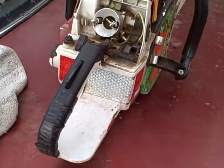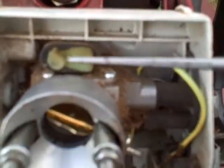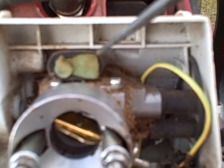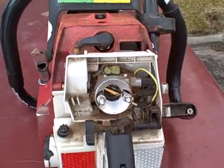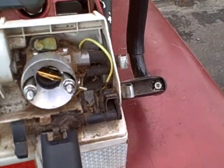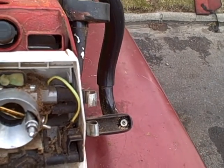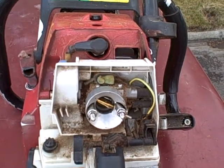Right across here is the most critical. Huskies are different than some of the Stihls, so you've got to be real careful which ones you get. If you look from this side, you can see right on top here — there's the diaphragms underneath this cover. You have to cover this with a filter or you will burn up your carburetor gaskets. So that's one thing that's real critical: if these saws come with the filtered style diaphragm, you must put a filter in there.